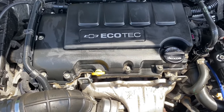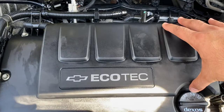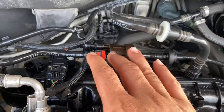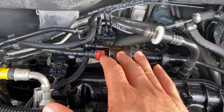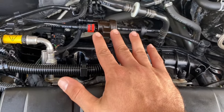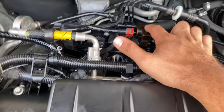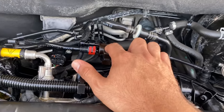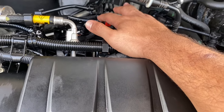If there is a vacuum leak, you may want to go ahead and address that. The second thing — these canisters right here can go bad too and they can cause an internal vacuum leak. Look at how much it's shaking. This can cause an internal vacuum leak, so you may want to check that out, pull it out, and see if it's vacuuming from there.